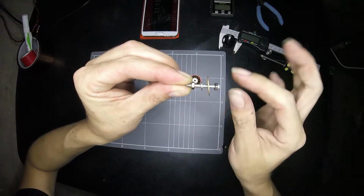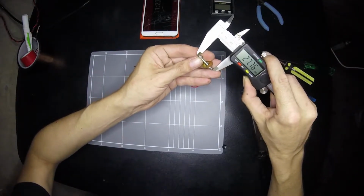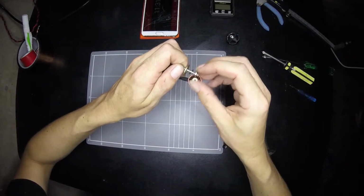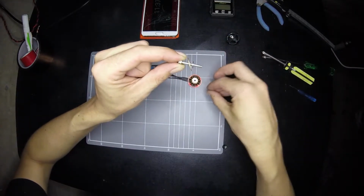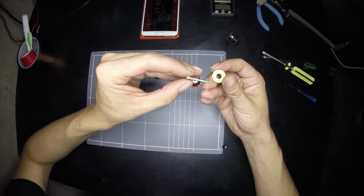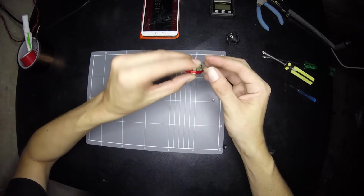We've got an M3, I don't know, what is it, 30 odd mil? Let's see. I've got calipers here, I should just measure it. So it's an M3 20, we'll call it a 25 mil. Yep, so M3 25 mil screw with 2 M3 nuts. I'm taking the first one off now. An M3 washer that I'm removing now. And some random Imperial washer that sort of fits over the bottom. So that goes on the bottom and just sort of fits flush.